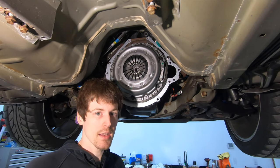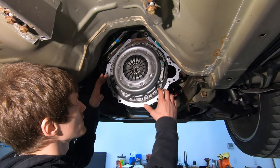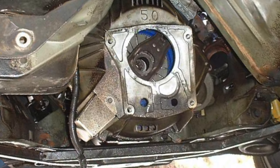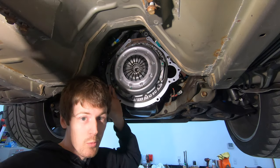The T5 guys — those with older stuff or a V6 — actually have it a lot easier because the bell housing is separate from the transmission, so you can drop the transmission separately. The guys with the 3650s and T45s, like myself, have to do it all in one big piece.